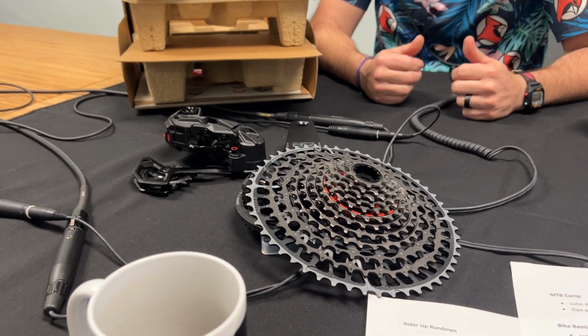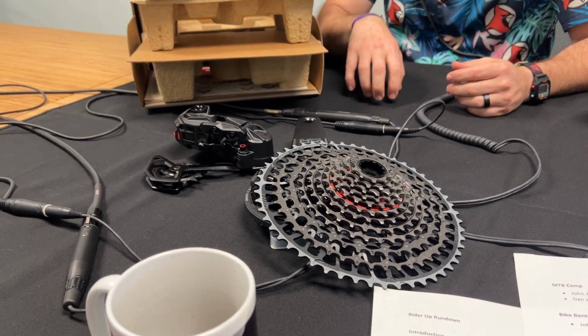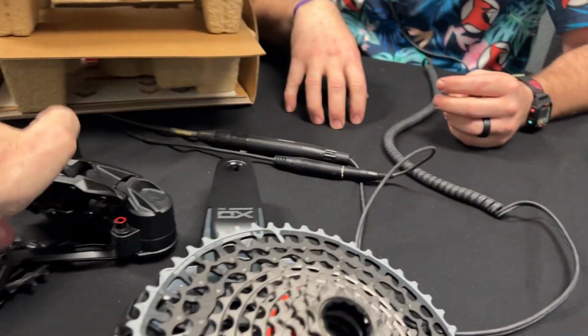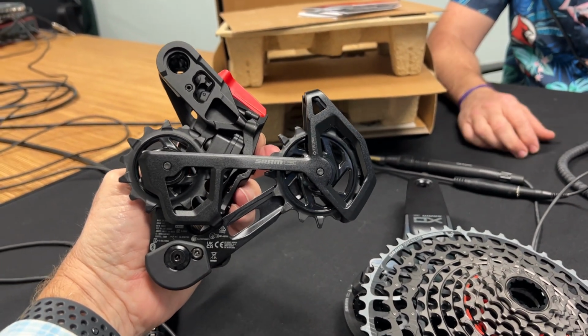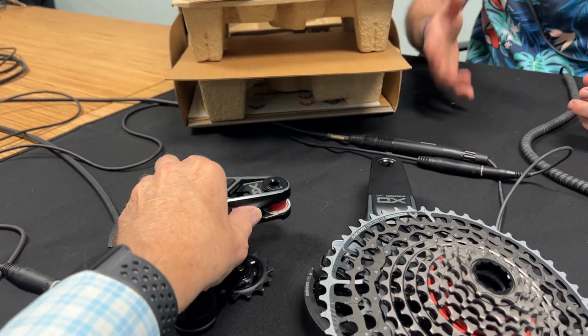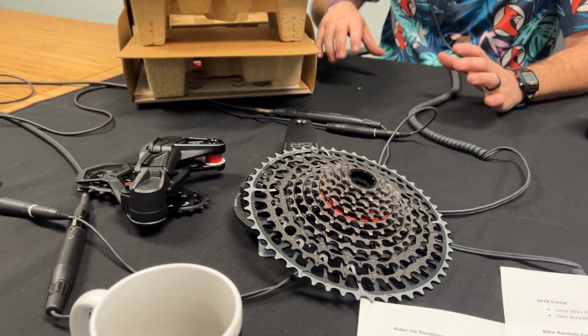So UDH has been around for a while. But more and more people are adopting UDH, or the universal derailleur hanger, as a standard. The nice thing is that if you go to the wheels manufacturer's website, there's probably 400 derailleur hangers out there for different brands, because they're milled differently and shaped differently and designed for different derailleurs and things. Well, now this is trying to reduce the complexity of what you need to have to put a derailleur on your bike.